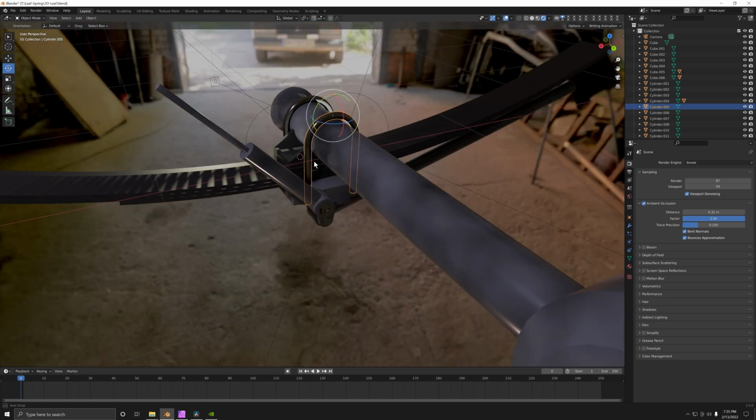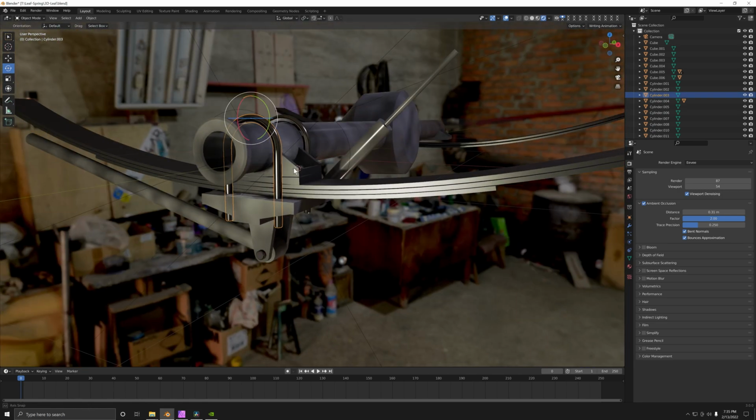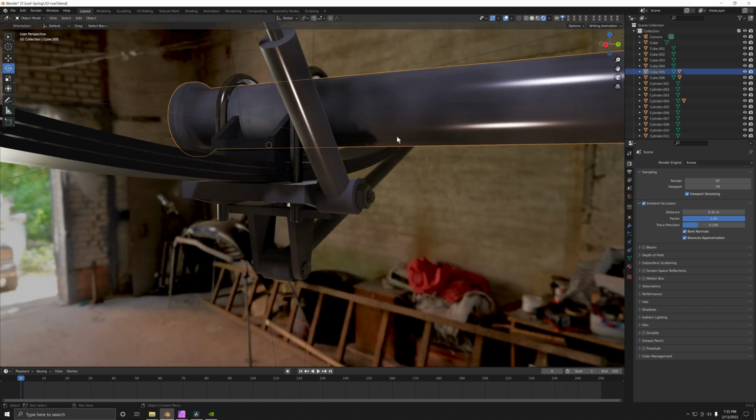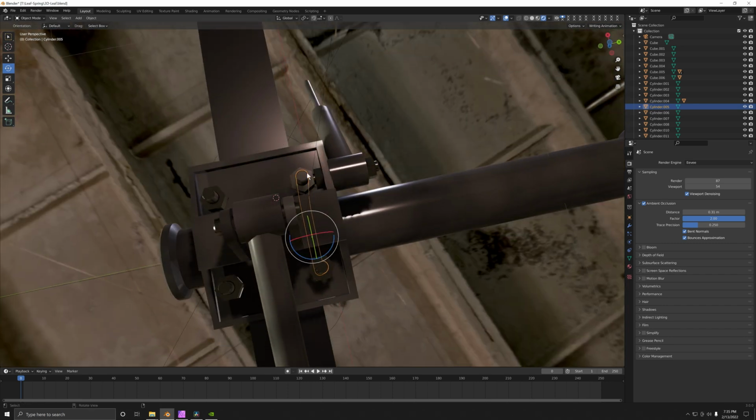Because it widens a lot. So a lot of the stuff for S10s are made for smaller U-bolts right here. So when you put a 9-inch in there, it definitely exaggerates this. And these guys sit more out this way. See what I'm saying? This way right here. So it gets close to where the shock is.